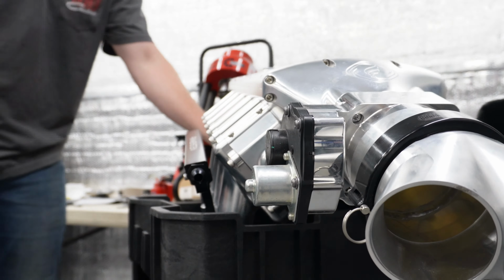So you've got the line here, you take this collar and you slide it over the line, push this line, this end right there, then you screw that on. Make sure the fitting is all the way down on the line. And then you come over here and you gotta make sure you've got the correct die in the crimper machine here. Slide that over there. Make sure everything's tight. And then you go till the light goes red if you've got everything set up right. Then there you go, your finished crimp.